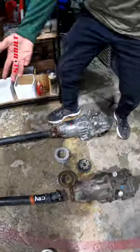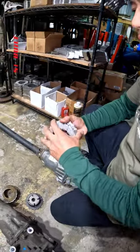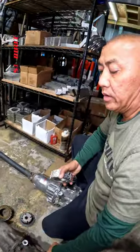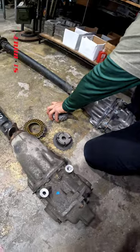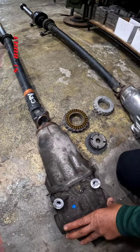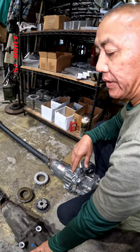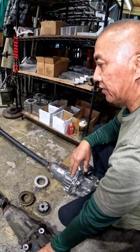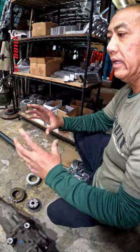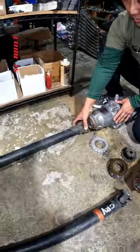So that's the main reason why we use these clutch locking plates. You could use this, I'm not saying you can't, but it will start slipping and you have to maintain it. If you use this with the stock everything and the CRV, you have to keep it to what the CRV power comes with, like 120. I wouldn't go more than about 300 horsepower, realistically. Some people say they use it around that, and anything above that, the back wheel is just slipping.